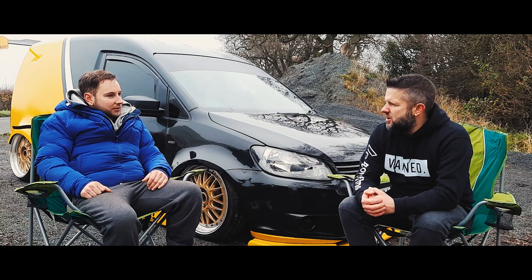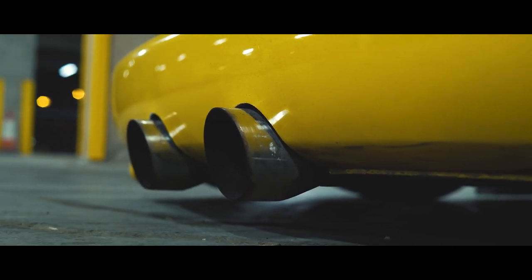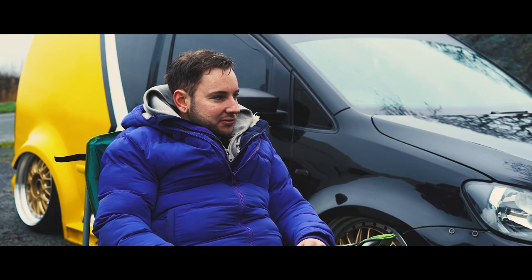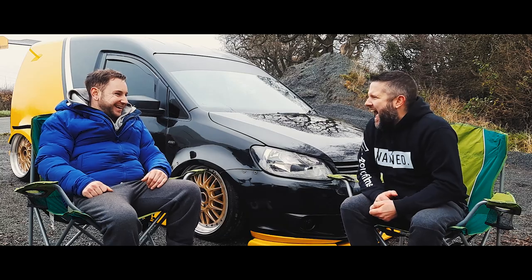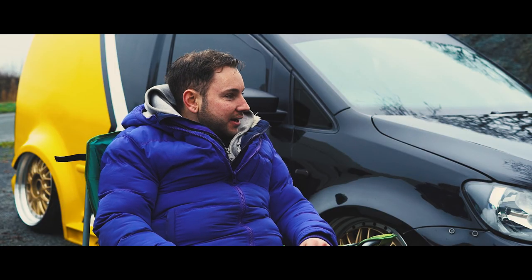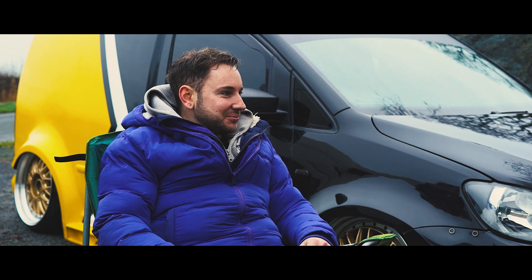And what exhaust have you got? Well, the exhaust is a decat, twin downpipes, then a 2:1 centre pipe. I do actually now have a small silencer in, 5 inch by about 14 inch. That's in now. I don't think it does a lot. And then just straight out the back to my Y piece, two tailpipes. But it's a pretty direct route, which I think helps put out flames and pop some bangs.